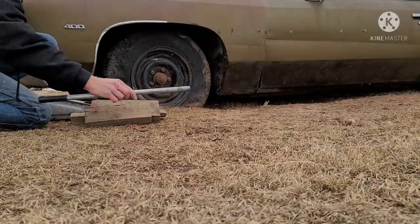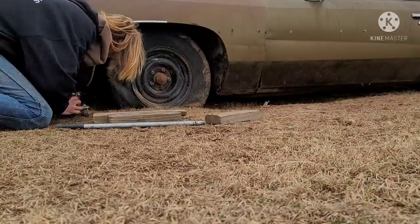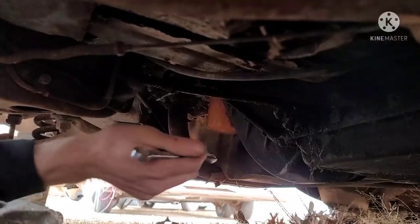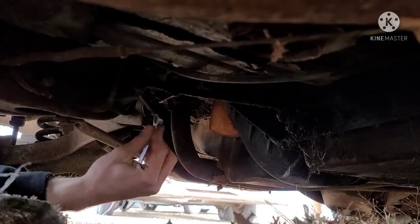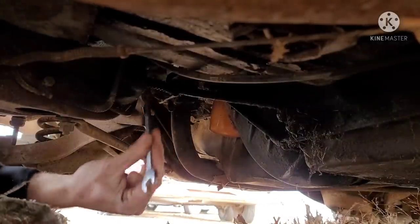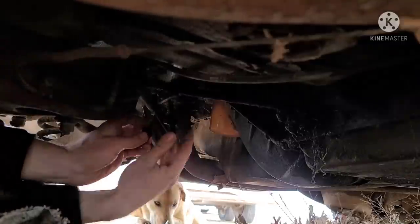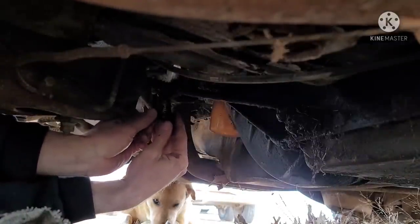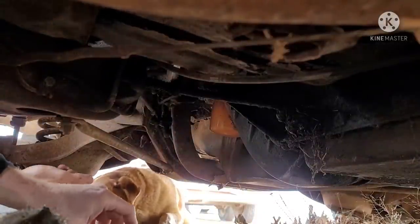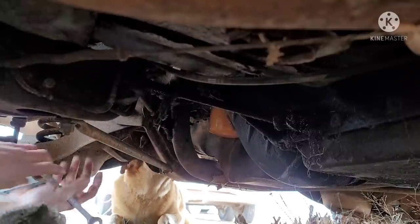Okay, now the locking steering column doesn't allow the shifter to be released, so we got to do that from underneath the car. There are several places where this shifter linkage is put together, so just whichever one a guy can reach. Undo this adjuster bolt. There's a little curved spring washer on there. Kind of an important piece you don't want to lose. What you sniffing, Sniffy? Two clicks to neutral. Boom, done.